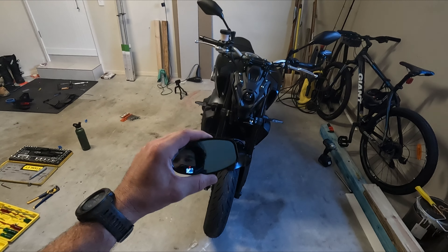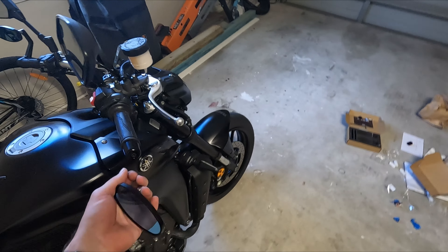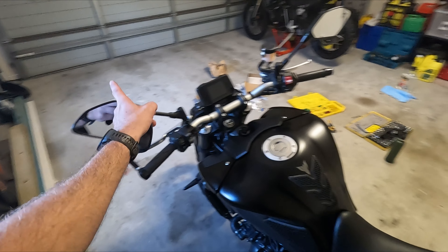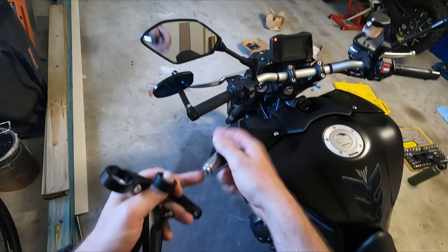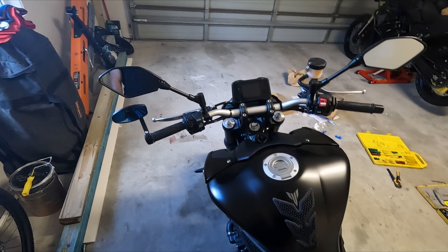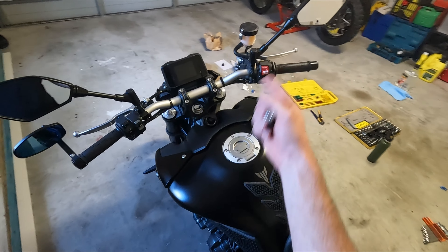These are the bar end mirrors from Rogue Motorcycles — much smaller than the stock ones. There was some confusion online about which bar end kits actually work, so I tested one side off camera first. Really easy: I just took the original bar end off and used the original bolt that was holding it on, pulled the internal stuff out so it didn't have to go inside, and the bolt tightens straight onto the end. Took about a minute. I'll need to order some black caps to cover the tops once the stock mirrors come off, but let's get the other side on.